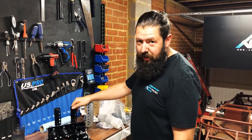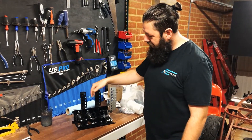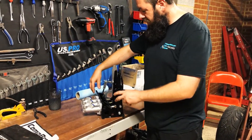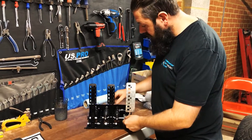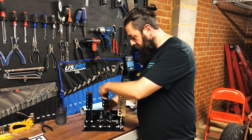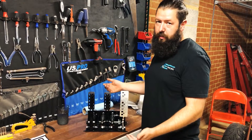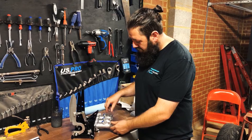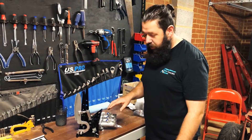The first part I'm going to show you is the pedal box — front pedal, brake, clutch — with the cylinders on the back. I've just thrown it loosely together to show you this part. This bit down here is a brake bias, so it pivots inside there as you press the brake pedal. You can set it up so that you get more fluid going to the front brakes or to the rear brakes, which helps with your setup depending on the circuit. The brake cylinders on the back are also different sizes — same size on the clutch and front brake, then a smaller one for the rear brake.